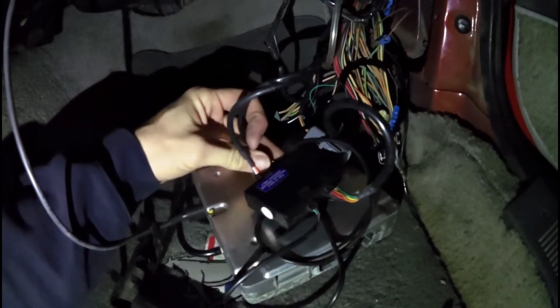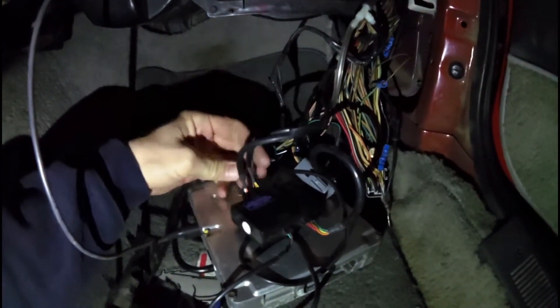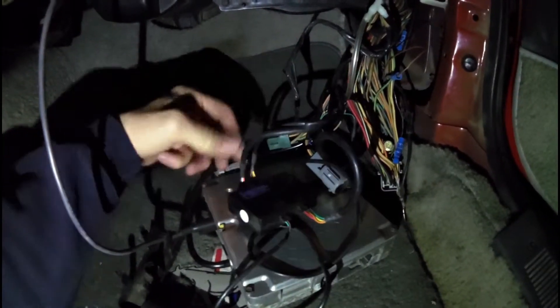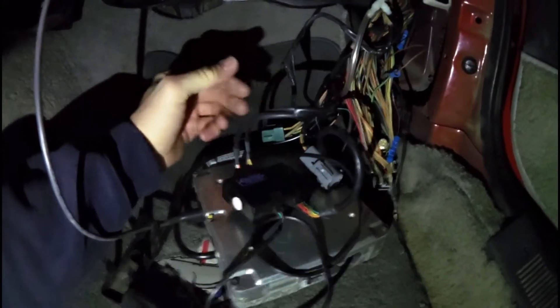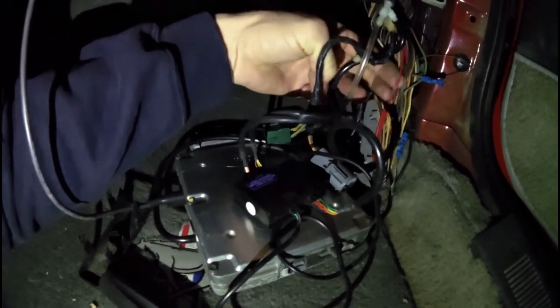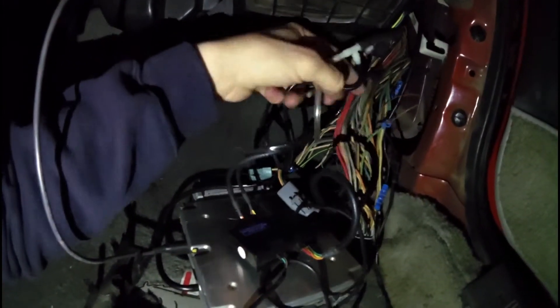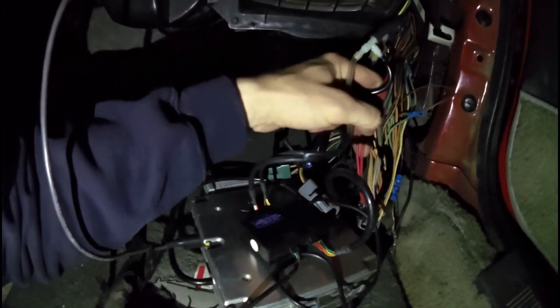There's another one that connects to the actual gauge. I've got my gauge mounted right down here in my console. You can bring power from any source as long as it's 12 volts for the one listed as your battery or constant power, and your switch voltage is usually right down here in your harness too. If you've got a Chilton's or Haynes manual for your car, it'll show you which wire is which — typically one of these red wires is going to be your constant power.